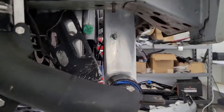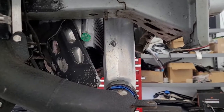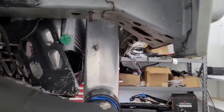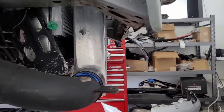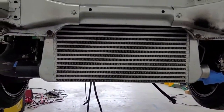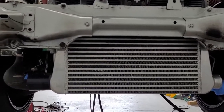And then here's another. So you see this intercooler. This intercooler is 12 inches tall and 3 inches thick, but I want to go to a bigger one. And if I do, you can tell there's a little bit of space between the condenser and the intercooler, but there's a good amount of room in front of the heat exchanger. Look at that, nice big gap. So we could definitely put a thicker intercooler. Also, the core is 20 inches across this direction, so we may want to get a bigger core lengthwise as well, you know, 24, 26, I don't know, something bigger. And perhaps even taller.